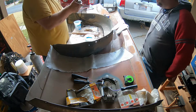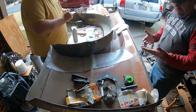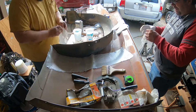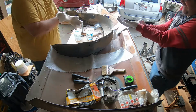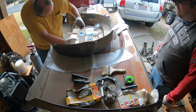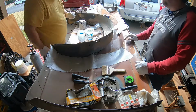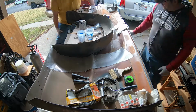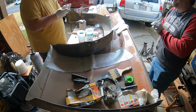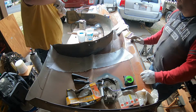Damien was right. The epoxy part was simple. I ended up buying a bunch of cheapy throwaway brushes, as well as some of these aluminum rollers, which shouldn't be disposable, but they kind of are, because once you get epoxy in them, they're hard to clean out. Anyway, the whole process here is pour 2 ounces of the epoxy, put in 20 drops of the hardener, mix it for 30 seconds, pour it in the location, make sure it's soaked all the way through the fiberglass, rinse and repeat.